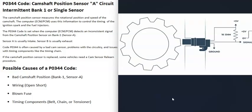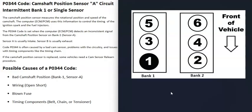It's going to be a matter of troubleshooting why. If you have a V6 or V8 engine, you're going to have two banks on the engine. Bank one is always the side of the engine with the number one cylinder, so if you Google the number one cylinder for your engine, that's going to be the bank one side. The opposite would be bank two. If you just have a four-cylinder engine, it wouldn't matter because you only have one bank.